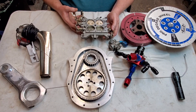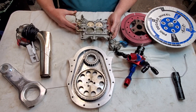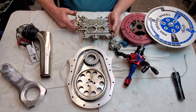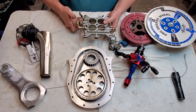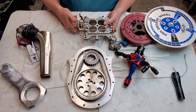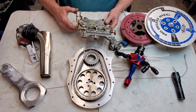If you're running a double pumper, carburetor, or any carburetor, first thing you want to do is make sure — have somebody sit in the car and mash the gas all the way to the floor to make sure you get wide open throttle. A lot of times people miss this; it's commonly overlooked.